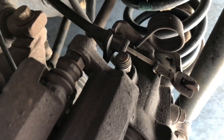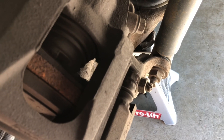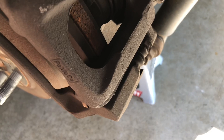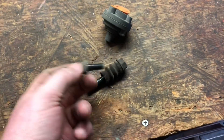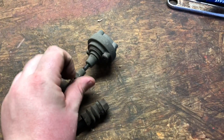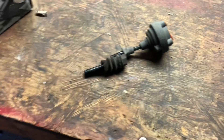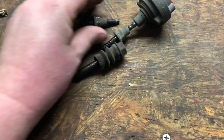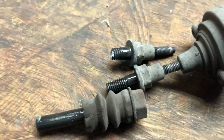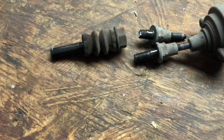So I got the top bolts off and the bottom bolt off this side. The bottom one came off a lot easier on the driver's side than the passenger side. I actually twisted off the bolt inside of the pin on the passenger side, which sucks because now I've got to get a new dampener. Here is a good dampener pin — this part screws inside your dampener, and this end piece goes inside the pin that goes inside your caliper. What happened was it twisted off. Luckily it goes inside this pin, so you don't have to get a whole new caliper — you just have to get a new pin.